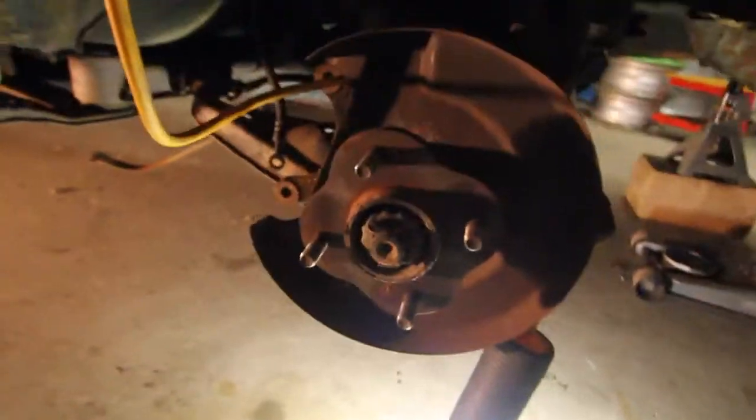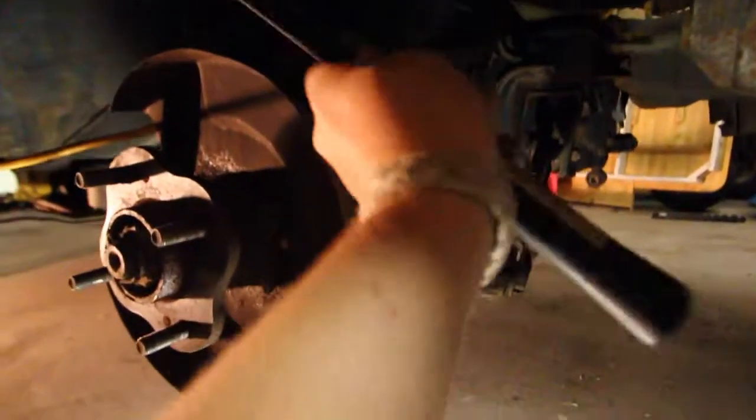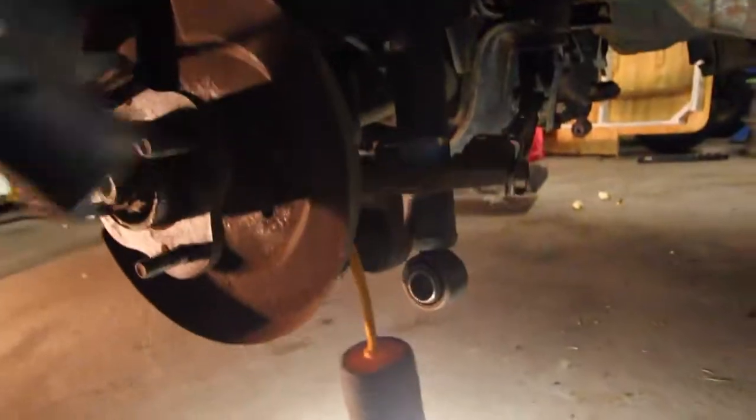Well, for the last hour my dumbass was tightening the bolt the entire time, so I finally realized it, and once I actually got it, it came out like butter. So now all we have to do is take out the strut. Just gonna bang it with a hammer really quick. Now I believe 4 bolts and the subframe will drop. I just have to set up the jack and then we can start doing that.